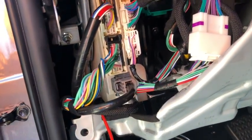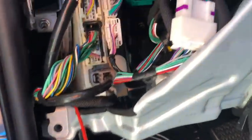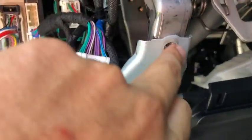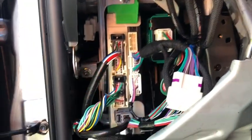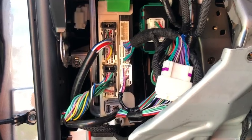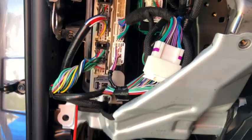It's a pink cable, pin 19. I removed the entire front plastic, unplugged the cables, and there are also four screws in here that I removed so I can pull this metal piece down. What I want to do is remove that one, remove the one on the back, and remove the entire fuse box so I can reach pin 19 and tap in there. I don't like to force anything, so I'm removing everything to get to that cable.